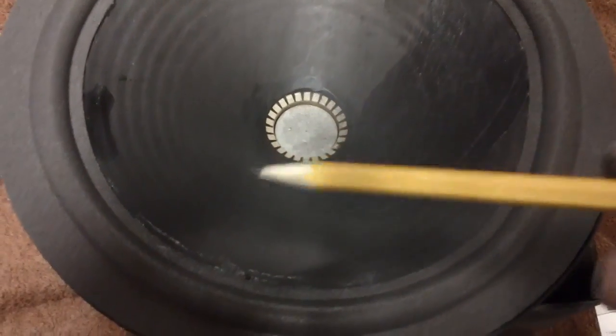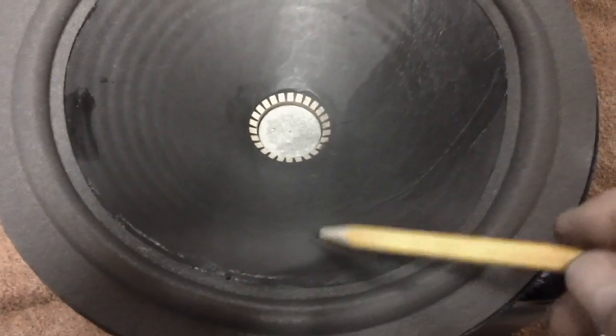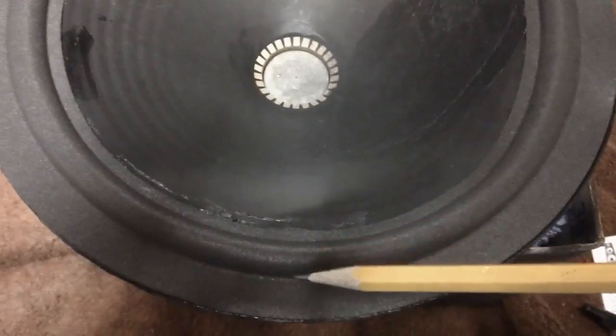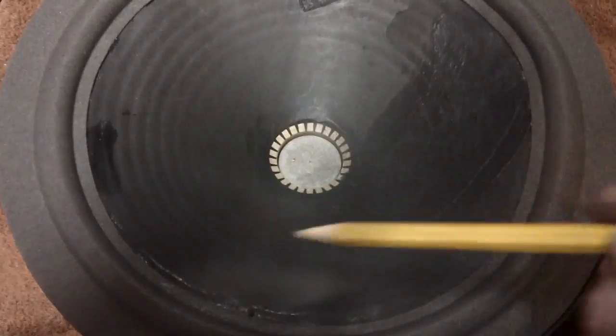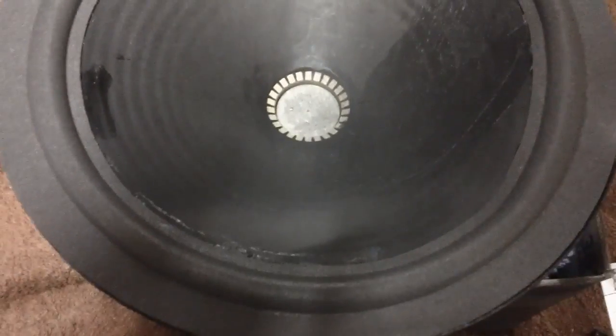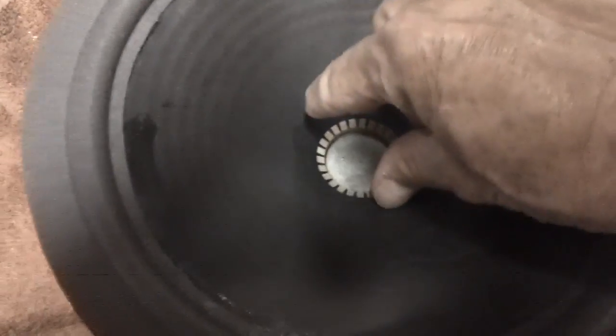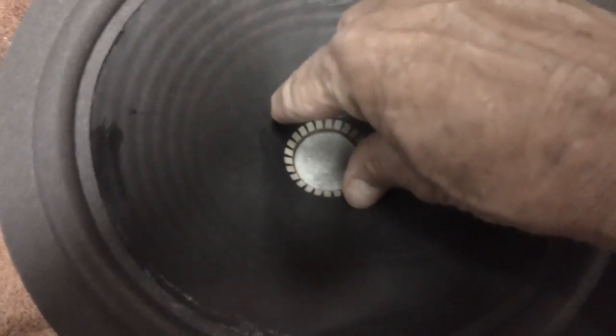One thing I did, by the way - on the newer speakers, that glue is almost like rubber cement and it'll roll off. A little bit difficult on this one for some reason. I discovered something when I was messing around with the speaker, testing it to see if it would rub. I discovered that if I pulled on this side here a little bit, it would quiet down. So I went ahead and put a spot of glue down in there to hold it in place. Look at that - quiet, just like that. So what I'm going to do is mark this spot right here with an X and let it set all night, so I'll know where that spot was.